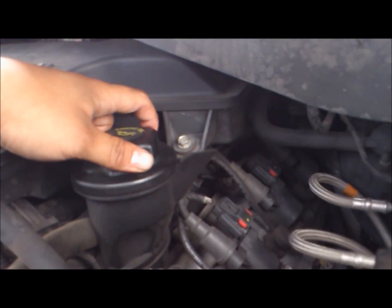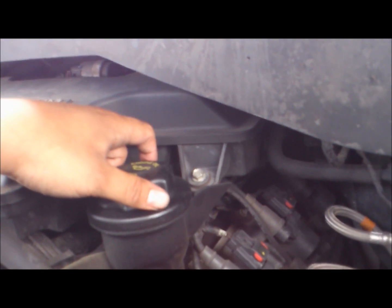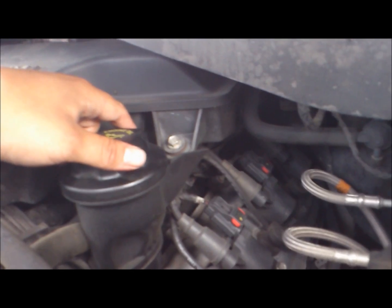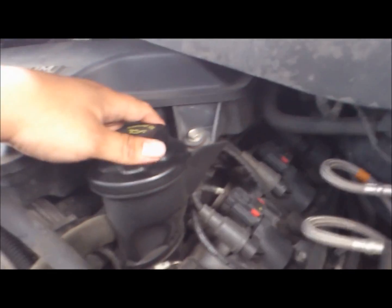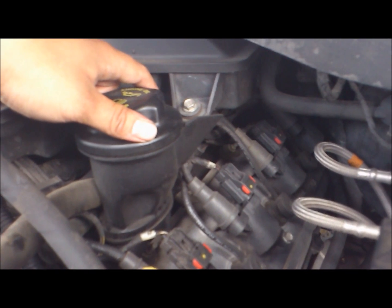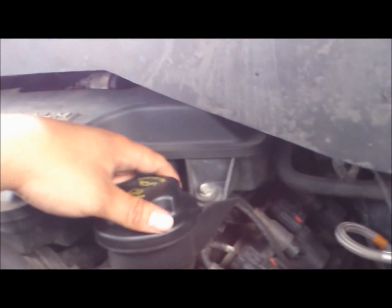And when giving it a start, make sure to record how many miles your car has, so you can plan for your next oil change, which I probably said earlier is 3,000 miles. It depends on wherever you are and your preferences and stuff like that. It should be every 3,000 miles or every 3 months, whichever comes first.